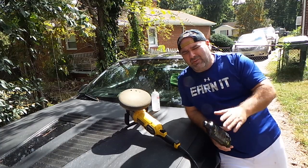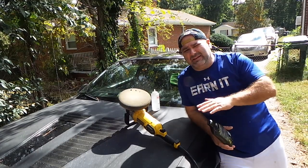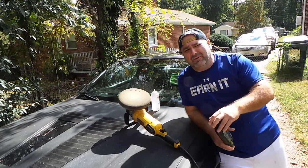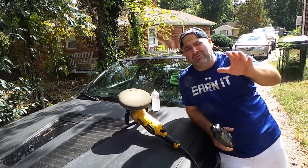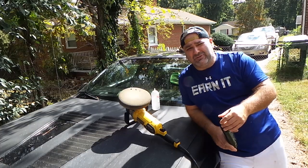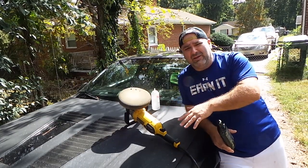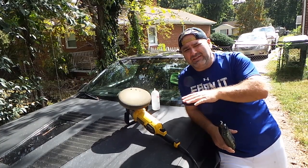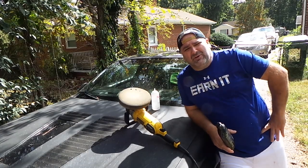However, the most important thing I'm going to do is use water, because this is kind of like wet sanding — or wet polishing, we can say that. Wet polishing is the way to go here because there's so much crap on here. The only way you're going to get down to real paint, smoothly without hurting anything, is with a nice little protective barrier for this stuff to glide on and kind of dissolve in.